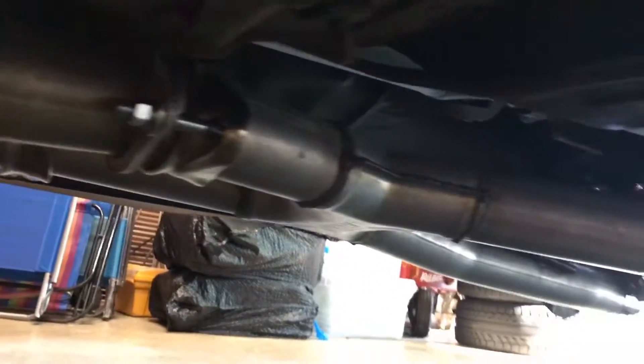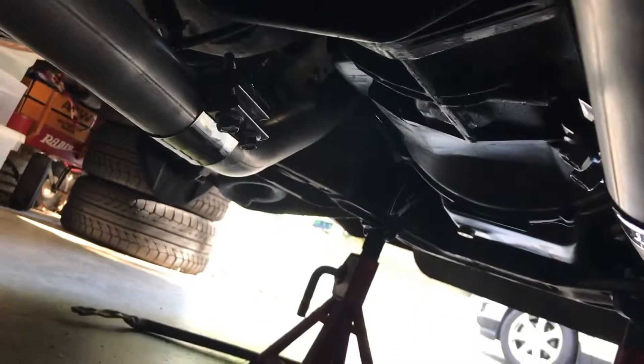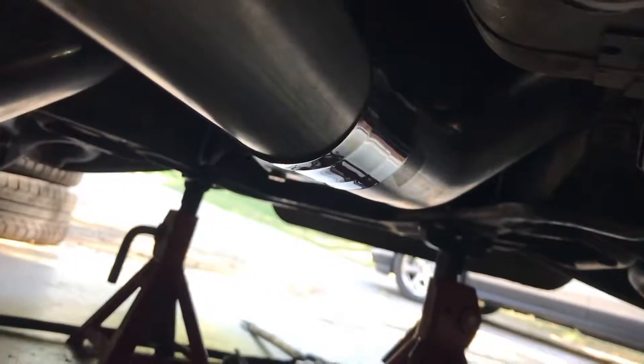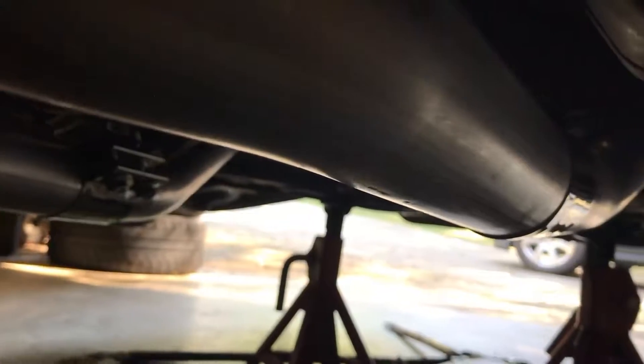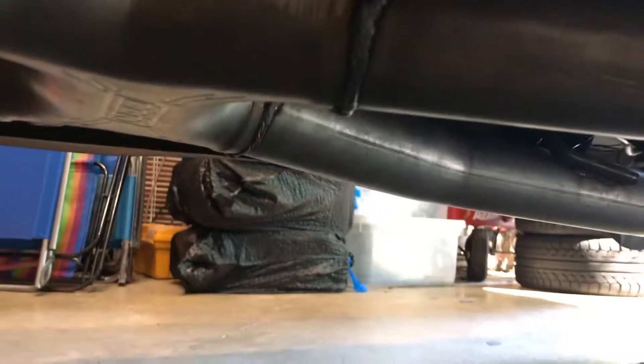Alright, so I've got the exhaust all buttoned up. Mufflers there, here's the new X-pipe. The BBK X-pipe came with these little brackets that hold the part going up to the header to the flatter section back where the X is. I've got some exhaust leaks there — I just cranked it up a second ago, so I need to try to tighten those up a bit more. If that doesn't resolve it I may just have these pieces welded, just to make sure they don't open up again. Other than that it sounded really good — nice and loud. Hard to tell exactly what it'll sound like on the road, but it sounded good in here.